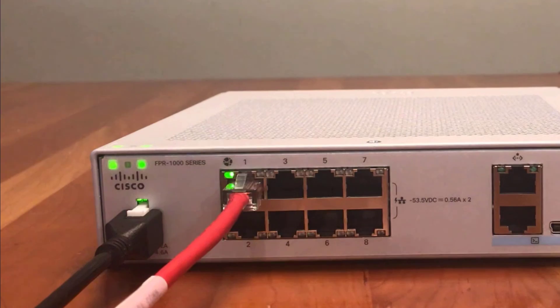In about another 5 minutes, when the device reaches the Cisco Cloud, the status light flashes green slowly — about twice in 5 seconds. If the device can't reach the Cisco Cloud, you'll see the status LED alternate green and amber. If this happens, check the cabling again to make sure that your network cable is connected from Ethernet port 1-1 to your WAN modem. If you've checked the network cabling and the green-amber flashing doesn't change to the slow flashing green light, call your IT department.